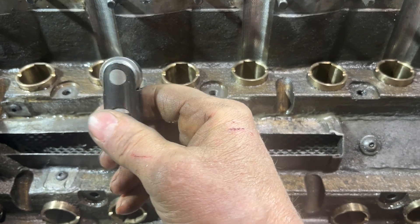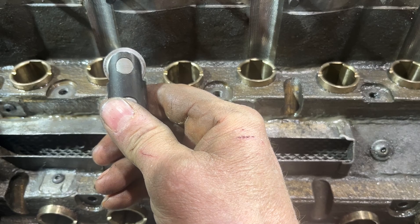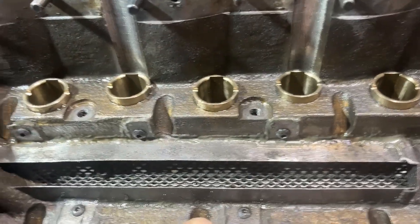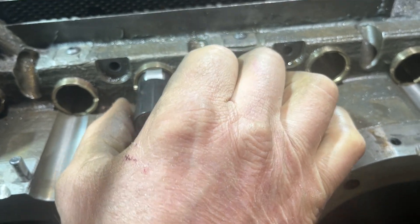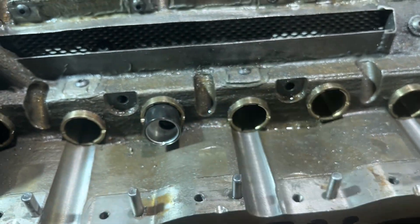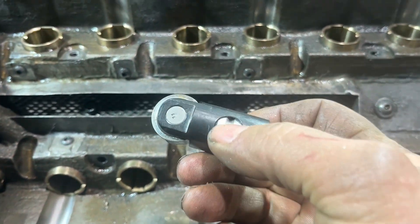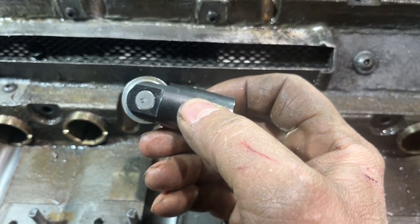This is the lifter that's going in — a 937 wheel-guided lifter. As you can see, the wheel is bigger than the diameter of the bore of the lifter. That's why these keyways are notched in the bushings, so that what holds the wheel center and what holds this from turning sideways is actually the wheel inside of that groove. There is a particular advantage to using the largest diameter wheel possible.